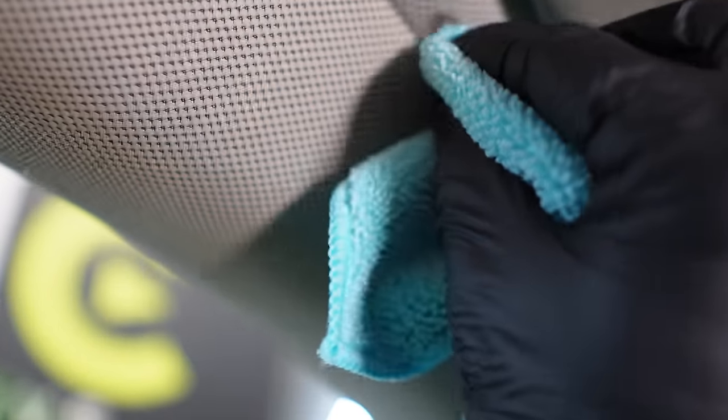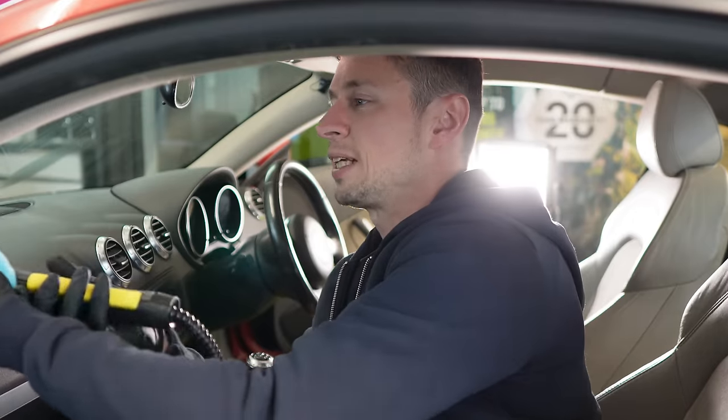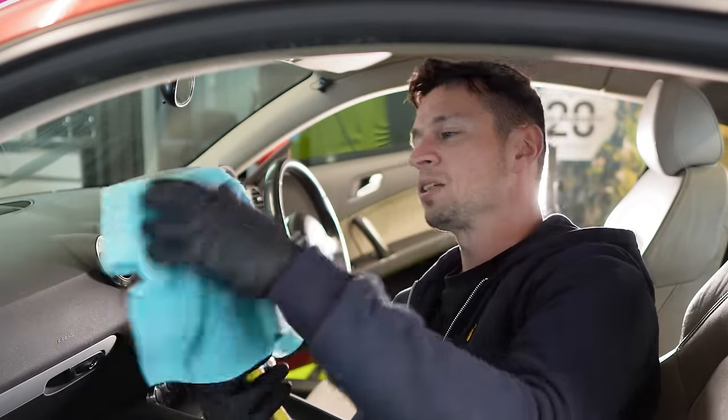If you look here, there's a cigarette burn — you'd need a dedicated professional who can restore fabric to tackle that. Because the burn has exposed some of the foam and other elements, that's another reason to be extra careful. I wouldn't go blasting it with steam; just take a damp towel and gently wipe it. I've done one pass with the steam and that's as far as I can go. Now I'm just going to tackle the pillar as much as I can.